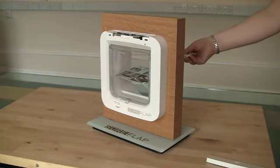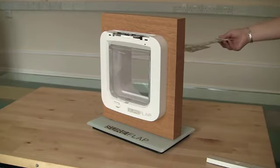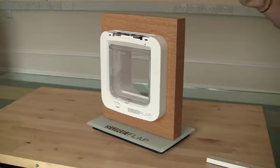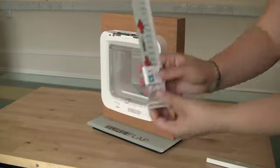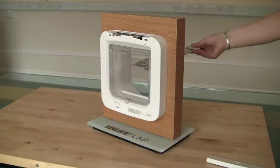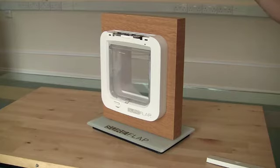the range tester. Now put the range tester back into the middle of the tunnel until it touches the plastic door. When the chip is close enough to be read, the motorized catch will drop down. We need to know the furthest distance on the scale on the range tester at which the door opens reliably.